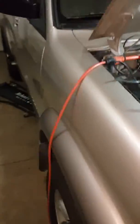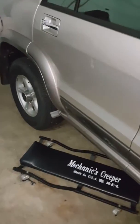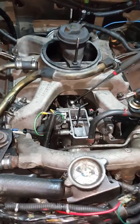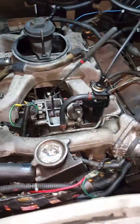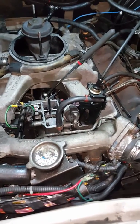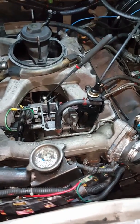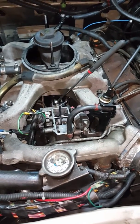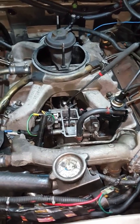If you're constantly rolling coal, then that means there's a lot of unburnt fuel going through there, high EGT temperatures. Now remember, this is a 6.2 NA, so I don't have the EGTs on there. I'd like to put some on, but I'm not going crazy here. From everything I've read and all the research I've done, I can safely go a 1/16 of a turn. And that's exactly what I did. I'm not going a quarter. A quarter's for the turbo models. If you're adding a turbo, you can go a quarter turn. So I'm going a 1/16 of a turn.